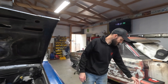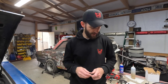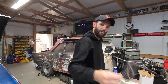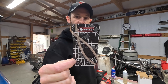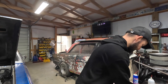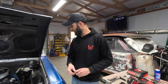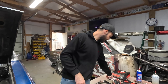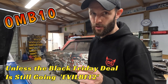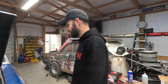There we have it — a simple fix to get AN lines onto your budget Holley carburetor. The solution is this particular fitting made by Russell, part number 640201 — I'll put a link in the description below. It has the correct threads to fit into your Holley carburetor that uses the small banjo fitting. Combine that with whatever AN fittings you need for your line routing and you're good to go. Don't forget to check out Evil Energy and use the One More Bolt exclusive discount code OMB10 for extra savings. Until next time — that'll do it!